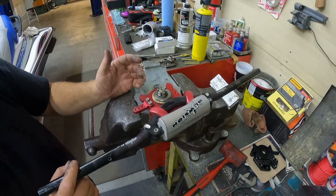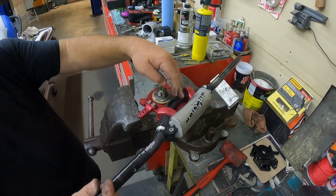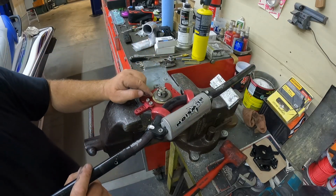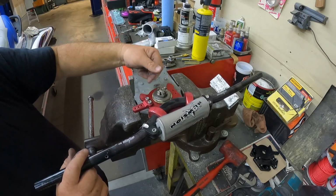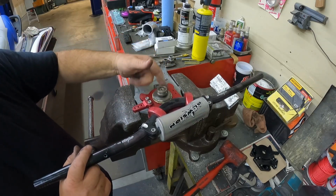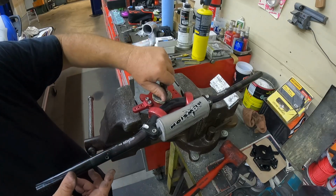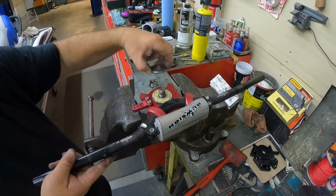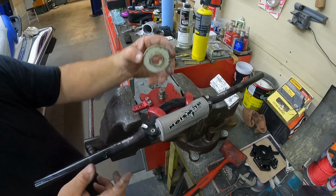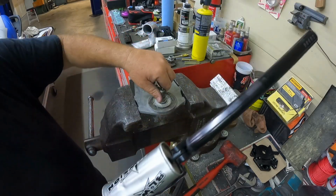All right. But just remember, with an aftermarket steering plate, you're going to use the 750 bushings, okay? And so you're going to need the 750 castle nut. And like I said, you'll have to modify them a little bit because this shelf is too tall here.